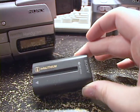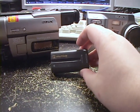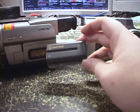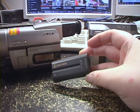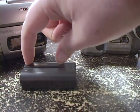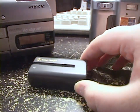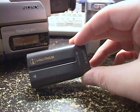Sony does not make this battery anymore, so if you're a fan of equipment that uses it, that might be a little bit of a nervous point. You technically can rebuild these batteries. Inside some of them are two 18650 cells. Cheaper, lower capacity models actually have smaller batteries inside. I'm not sure if the Infolithium circuitry prevents it from working if you replace the cells, but it is physically possible — you've got to cut the battery open, and I've heard of people trying that with success.